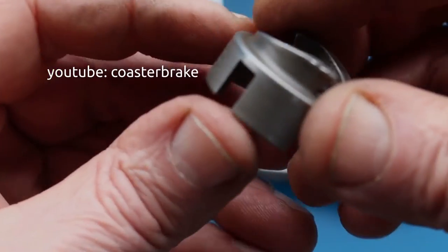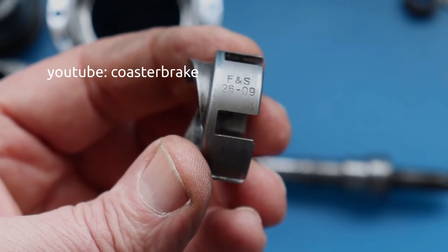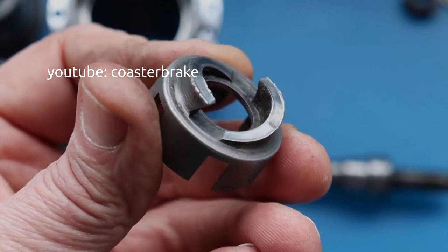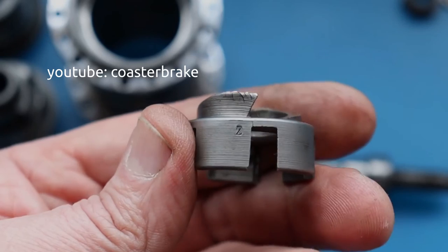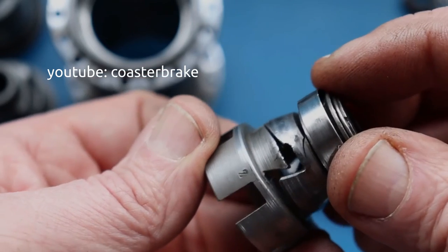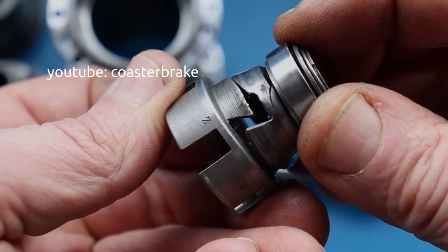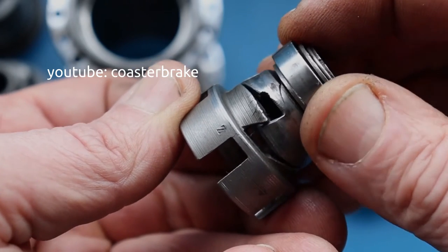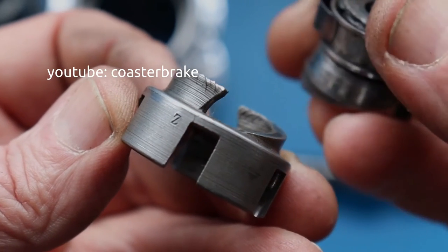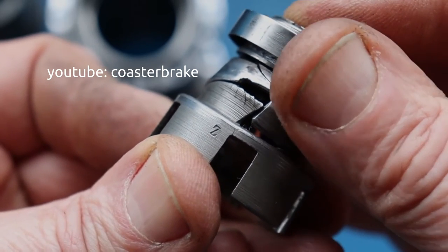The next part is a roll holder, and it is damaged — both noses above the roll holder from 1926 are damaged. Let's look together: if we put the brake cone on the roll holder, the brake cone does not touch the two noses. It is very, very damaged. So I think the roll holder was used from another Torpedo to repair this Favorit, because the hub was repaired around the time of or after the Second World War.